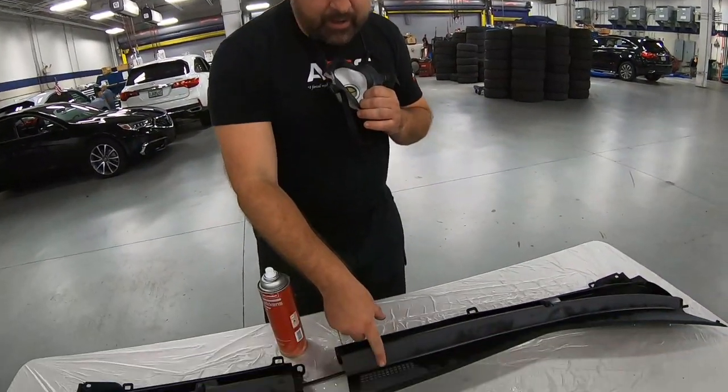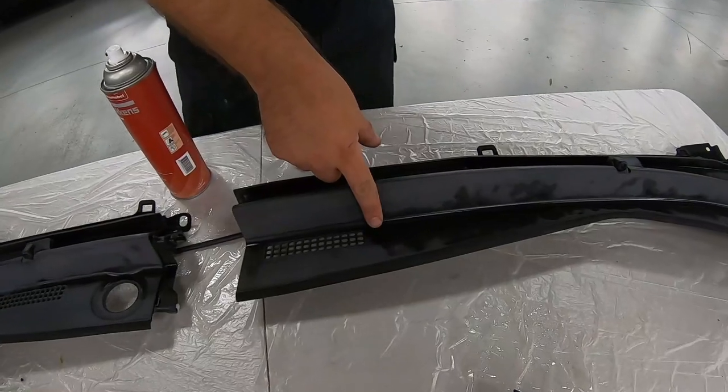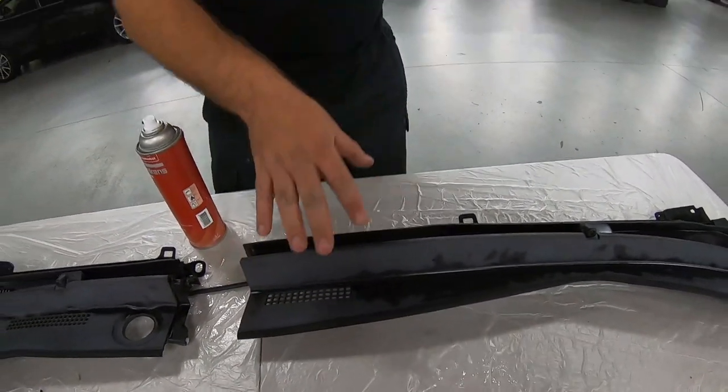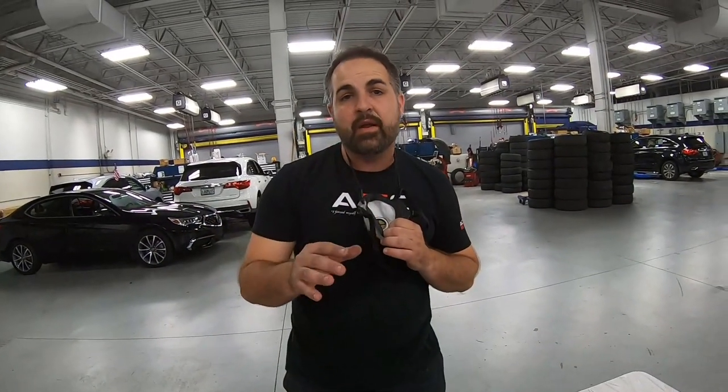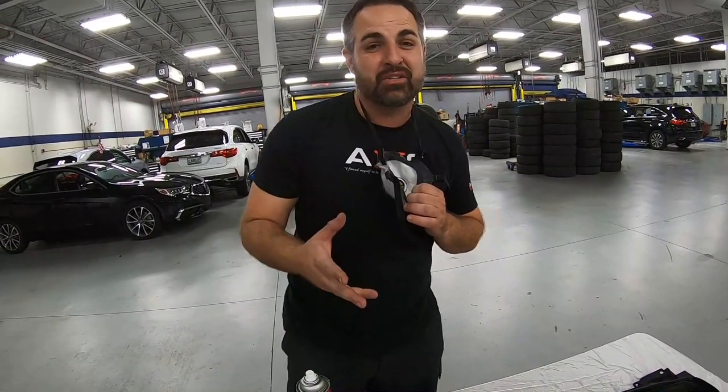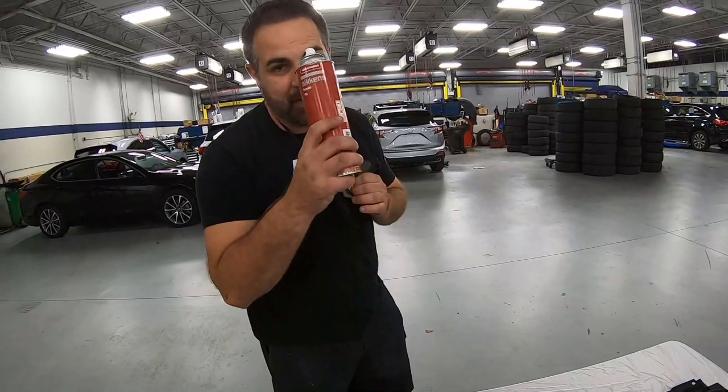And you can see right here, you see how it's already flashing? That means it's drying. So this is where we sprayed and this is the flashed area. Once everything looks nice and dull once again, we know that we're ready for our trim paint. Let's give it about 10 minutes and it'll all be nice and dull just the way we started, but it will have the extra bite with the adhesion promoter.